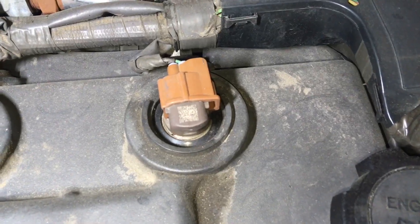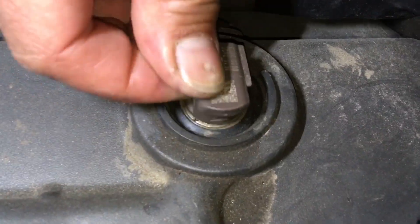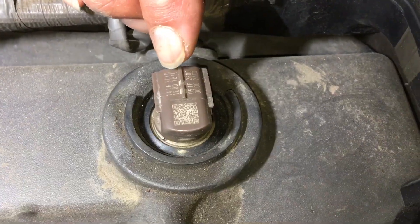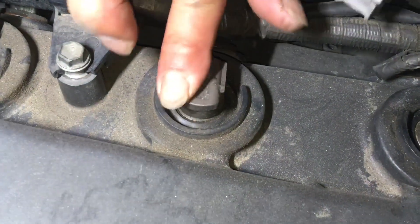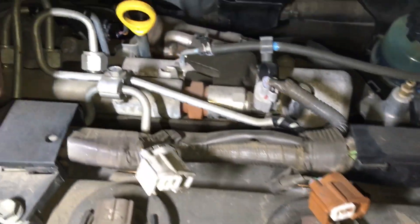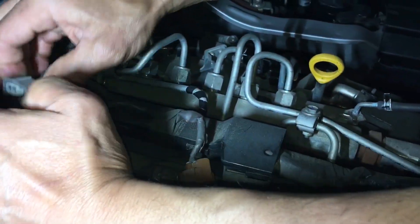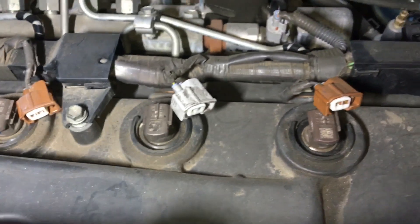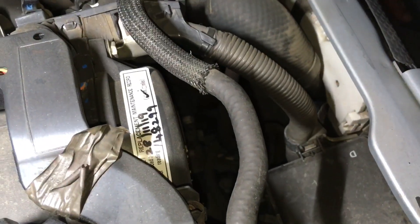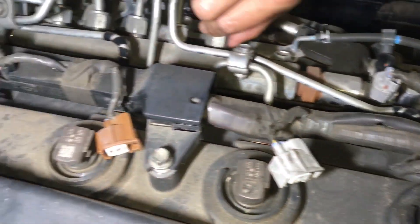Can you please unplug that injector plug right there? Tell me the first two digits on top of the injector. First thing we're going to do before we start an injector job is confirm. Looks like a 1-4 to me. They're all going to be a bit dirty or worn. There's the pipes — looks like they've been out before by the look of those clamps. That's definitely a 1-4. The timing belt has been done, which is good.